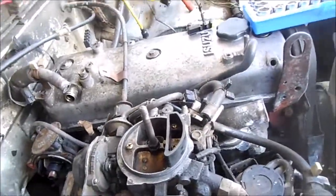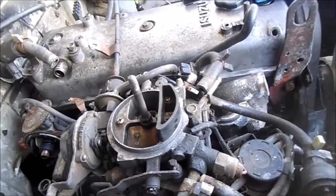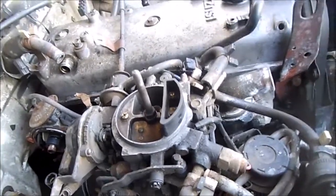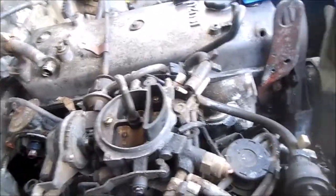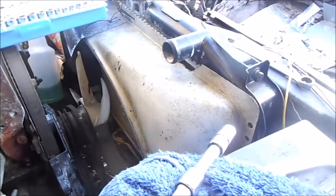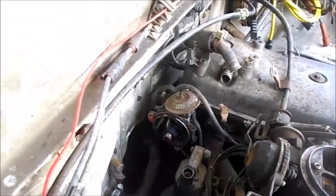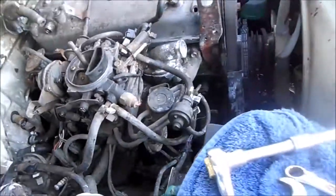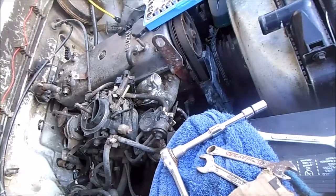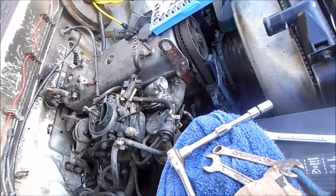The story on this one: I was running it and it started puffing out a little white smoke out of the blue — wasn't driving it hard. I put block sealer in there, re-torqued the heads, and it worked for a while, but it kept overheating. I popped a new radiator in and it ran fine for about another year, then just out of the blue it burned its valve. Quite the project, but it's an old truck and I think it's worth putting some money into. I'm so damn proud of it.